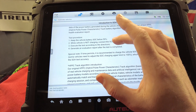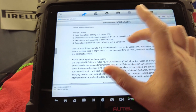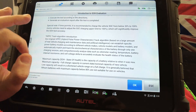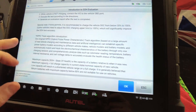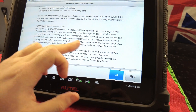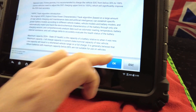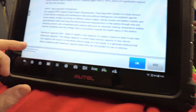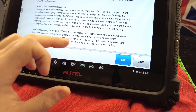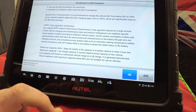Test procedure: keep vehicle battery state of charge below 50% — we're good. While the vehicle is not charging, connect the VCI to the vehicle OBD2 port — that's done. Execute the test plans according to directions and generate an evaluation report after the test is complete. The algorithm is based on a large amount of real-world vehicle charging data. State of health is the capacity of a battery relative to when it was new. Low capacity will result in shortened vehicle range. It is believed that lithium batteries with maximum capacity below 80% are not suitable for use on vehicles — though a lot of OEMs will only change the battery at 70%.